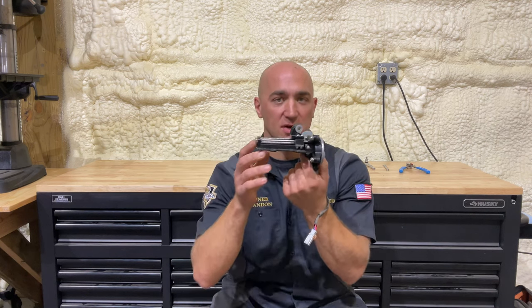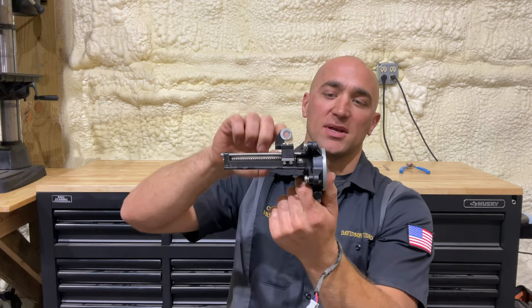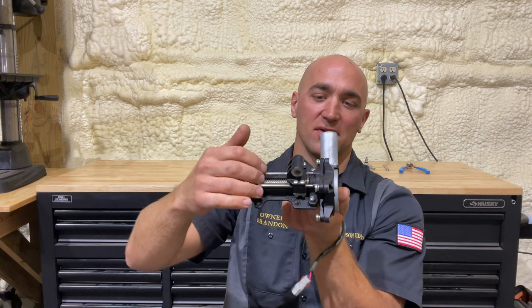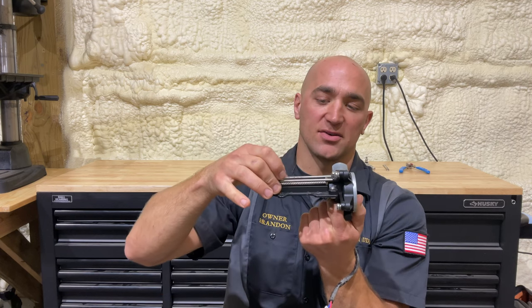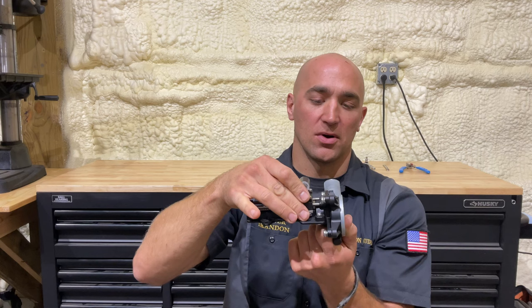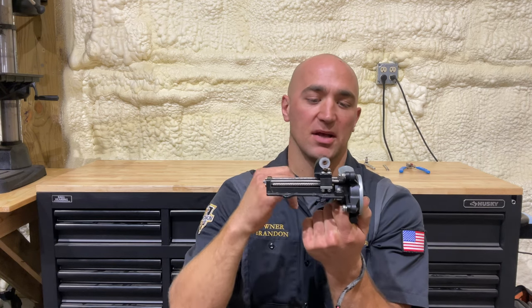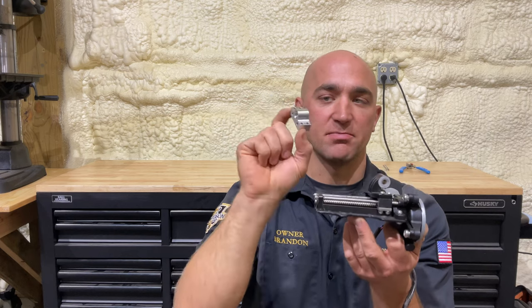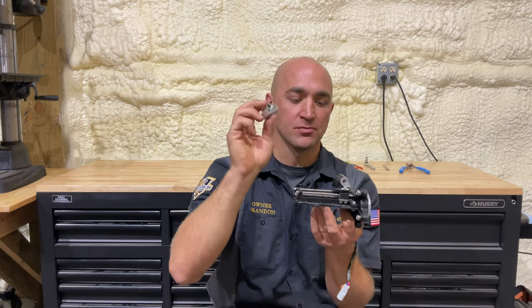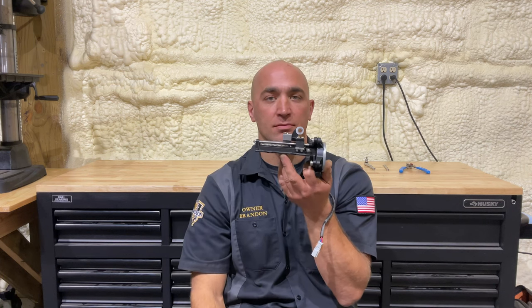All jokes aside, Steve Novak had this nice billet piece made ahead of time before everybody started realizing how bad these were, because he wanted to correct this issue. The issue with this motor assembly from Indian is that this piece right here is plastic, while all of this is metal. As you go down and up, or use the auto up and down feature a lot like I do, it'll ride all the way down, stop, and this gear will turn just a skosh more — or go up and do it again — thus weakening and stripping it.